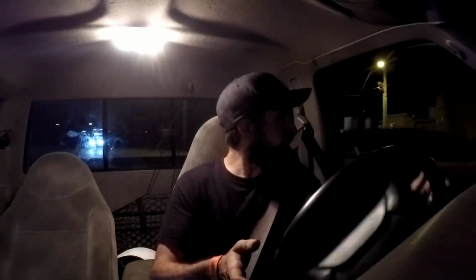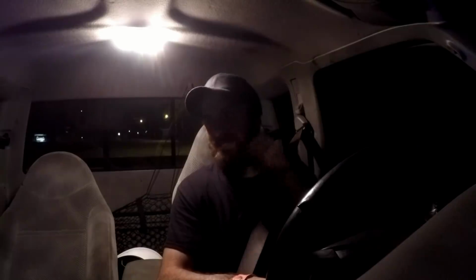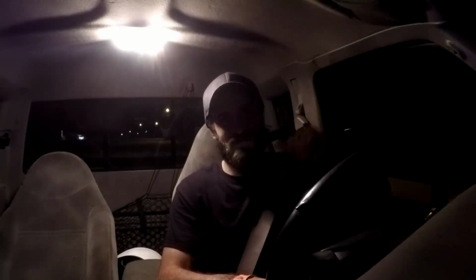Success of the night though, one other one I guess, maybe it's not that much of a success, but my intake air temps seem to have come down a little bit. Not a lot, but a little bit. They seem to be coming up quickly, but they don't continue to rise very fast. So it gets to like 160 by the 8th mile, which is kind of high, but it doesn't continue to climb really fast after that. So then again, I never did a full pass, so it's kind of hard to say at this point.